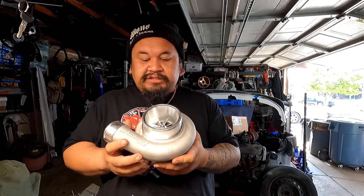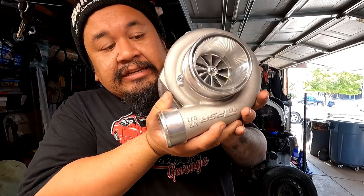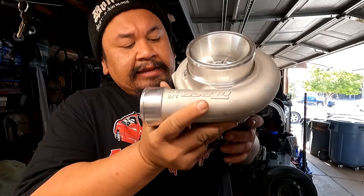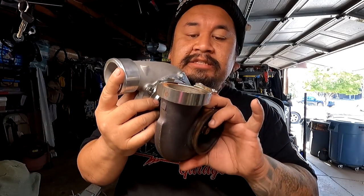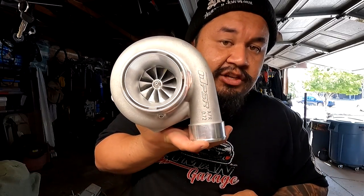Let's go ahead and grab some of the parts on the floor and show you guys what we are rocking with. You guys should have seen in the clutch installation video for the Honda Element we revealed a little bit of the turbo kit. Unfortunately none of that stuff is going to work because of how small and tight the engine bay in the Element is. My buddy SI ended up selling everything he had originally bought for his build but he did keep the PSR GT35 turbo, which should be good to around 650 horsepower. It is a V-band style which is going to help a lot with taking the turbo off and on the manifold.